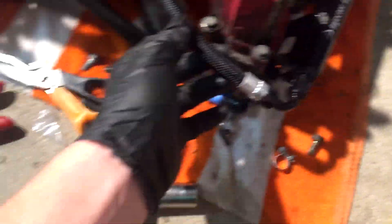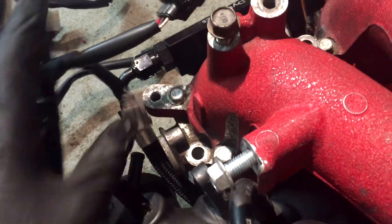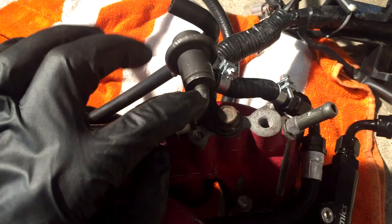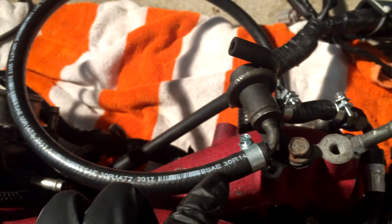To get to the fuel routing: the 5/16th supply line goes into your first fuel rail, first two injectors, goes over or under the manifold — it's a pretty big line — routed under into the back side of the passenger rail, through the passenger side rail, into this line. I routed this line under and then around to my relocated FPR, which right here has a barb fitting. There's a barb under here attached to 5/16th fuel hose clamped by two fuel injection clamps.